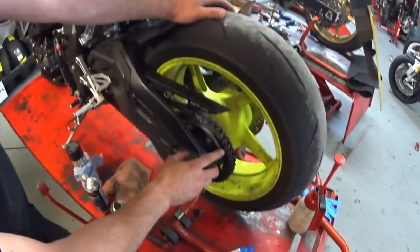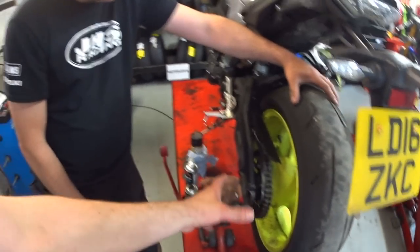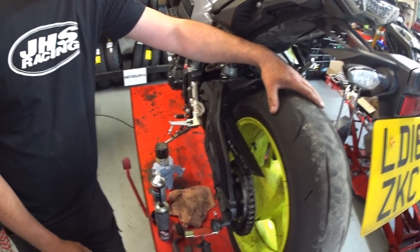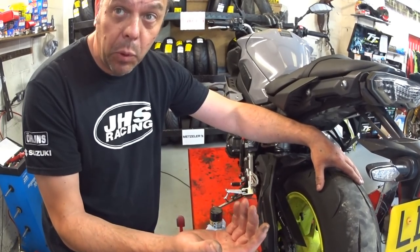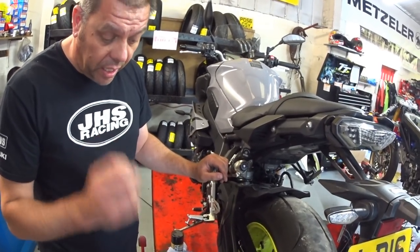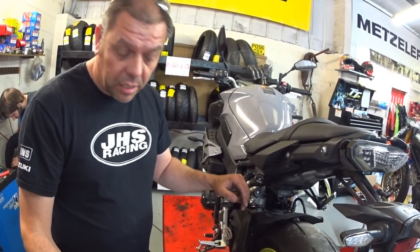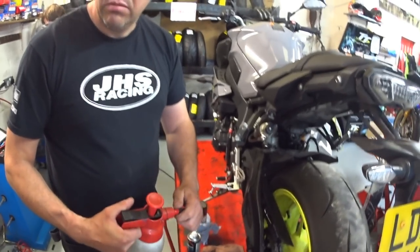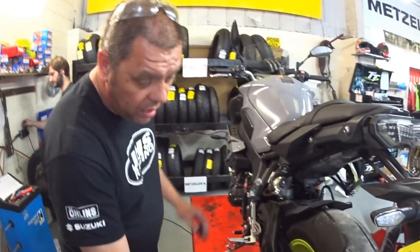You've got to go with what you like, and you're not a fan of wax. But fair enough — wax does make a chain look very presentable straight away. Going back to the chain though — literally doing that for just a couple of minutes. If you were to do the whole chain it's going to take you half an hour, working each bit. Once you've got the worst of it off you can use your bulk products — a chain cleaner and chain lube kit — and you can keep on top of it really easily. The chain cleaner is just a slightly weaker version of the degreaser. We've also got brake cleaner in this one — common garden brake cleaner, available in aerosols.